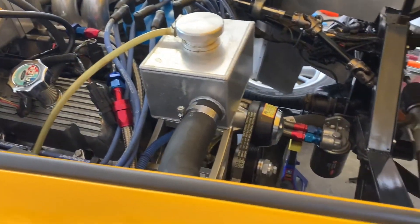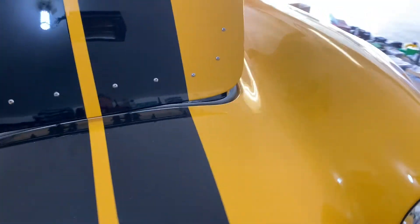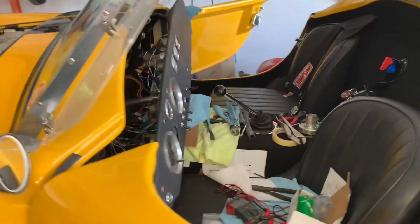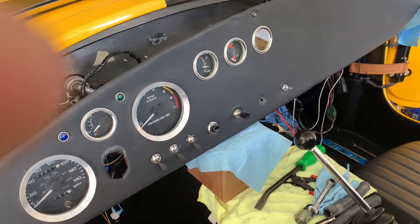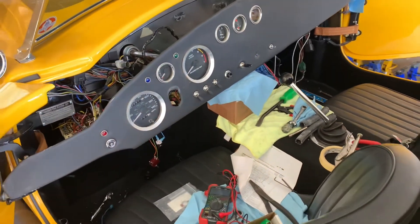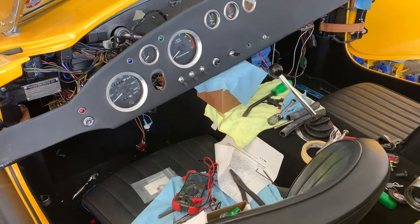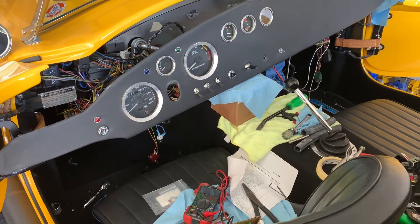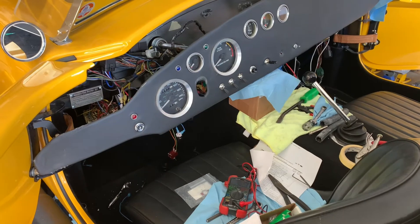I don't see any drip underneath the vehicle, everything looks good and dry with no puddles — that's a plus. The only thing I noticed is the temperature gauge. It's the factory Mustang gauge modified to fit and it never moved above that mark. I think something's wrong with it. It does go all the way down when you turn it back on and it's cool, but never goes past that point. So one of the first Auto Meter gauges I'll buy for this conversion is going to be the water temperature gauge — probably sooner rather than later.